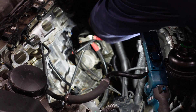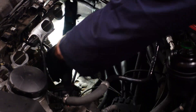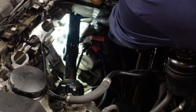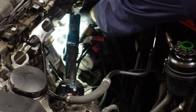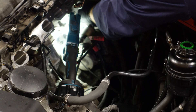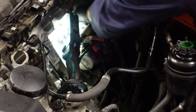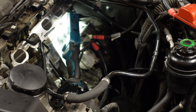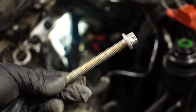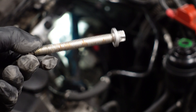I'm just going to hold it on while I just remove it out of there. You're going to need light for this as well to be able to see when it's maneuvering out. A few turns and it should just come free, and you'll be able to see just exactly how long that bolt is. This bolt is very long compared to the other one. The short one goes in the front and the long one comes in through the back, so do remember that.